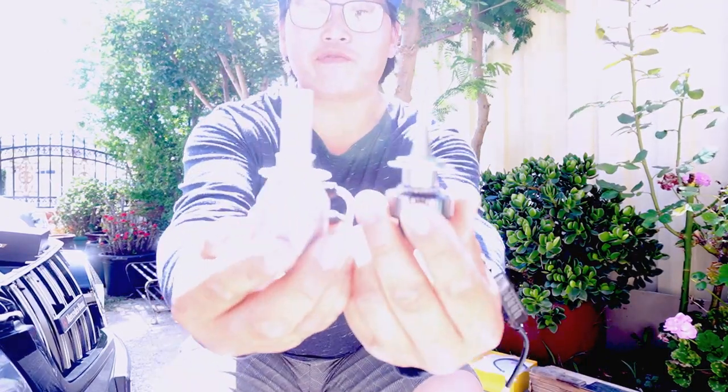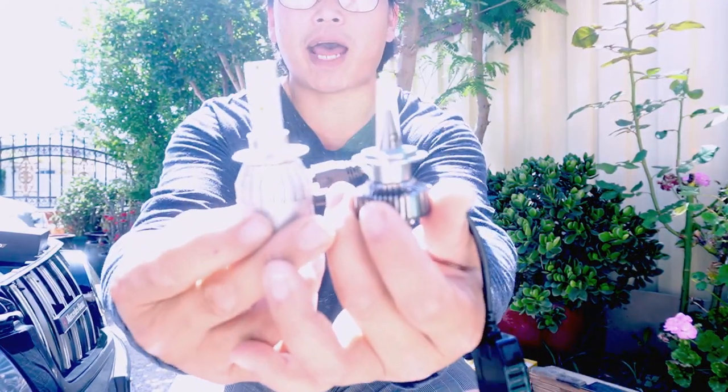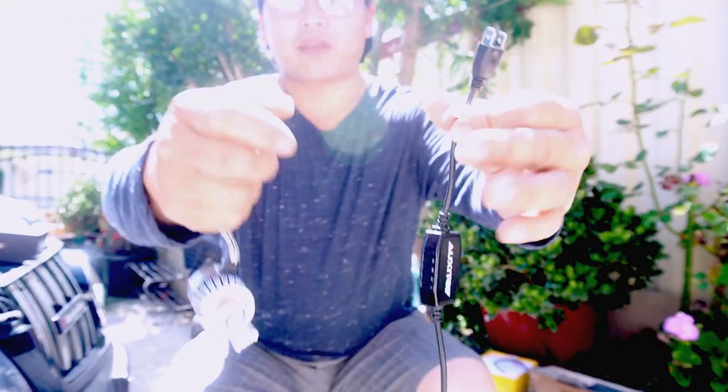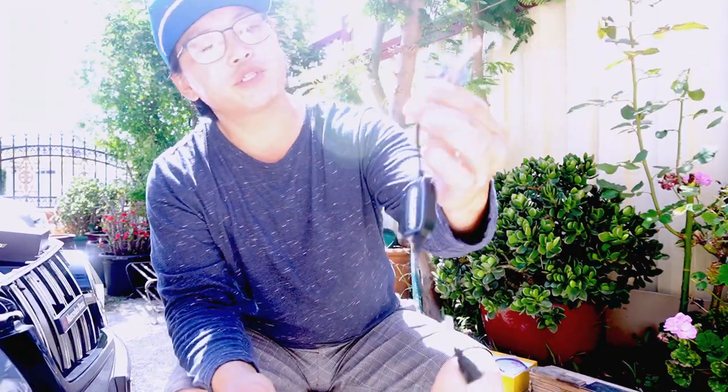I needed a set for my older style. I wanted to compare the Auxedo to this cheap style LED bulb which you can get for like 10 to 15 dollars, and you can see there is a massive difference in size. This does look very cheaply made by comparison. Having something very compact is going to be a big bonus — this cheap one is huge compared to the Auxedo one. Auxedo also gives you a longer cable if you need it. The reason the cheap one is massive is because everything including the fan is built into the bulb body, whereas Auxedo has installed it all into a separate little box. That is a pro and con depending on how much room you have in your headlight. Because the W204 headlight has so much room, either works fine.